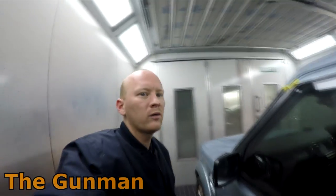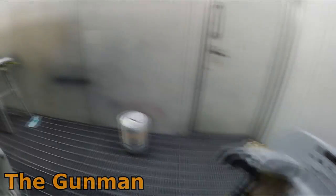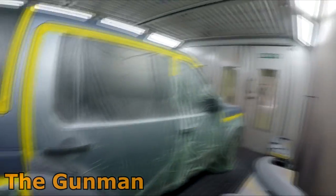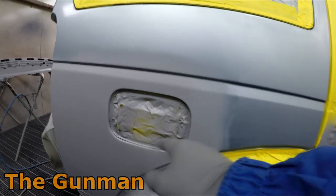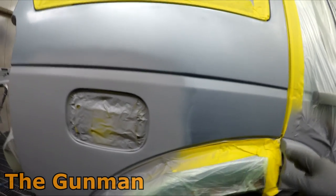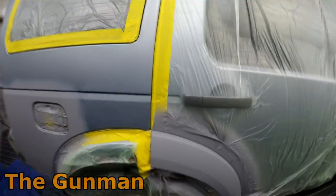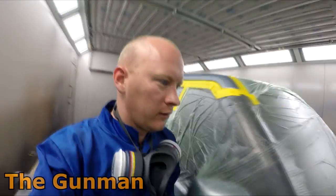So that's me with the wet-on-wet primer down — covered up all those bits of bare steel, put a quick coat over the rear bumper and those couple of parts down there as well. I ended up getting a little bit of overspray from the wet-on-wet primer over here, so I just got a thinners rag, wiped over that, and then wiped it back over with the water-based cleaner so I didn't ruin the blend. When I paint this again I'll put another piece of paper up over there and peel it off when I'm ready to do the quarter panel blend.